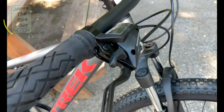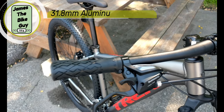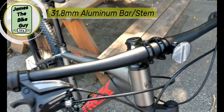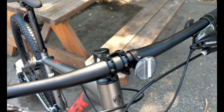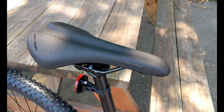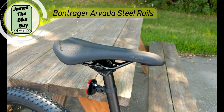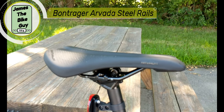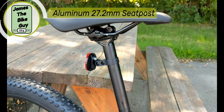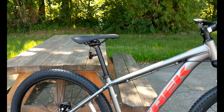What's really nice is that the bike has an aluminum cockpit — an aluminum handlebar and stem, both Bontrager, with a 31.8 millimeter bar and stem. For a seat, it has the Bontrager Arvada saddle, which is actually pretty comfortable, running through an aluminum Bontrager 27.2 millimeter seatpost, which is a slightly smaller diameter than most Trek mountain bikes.